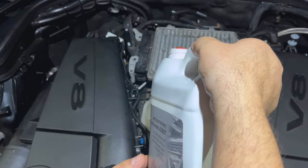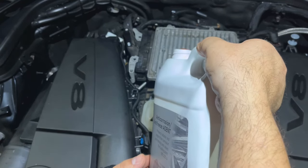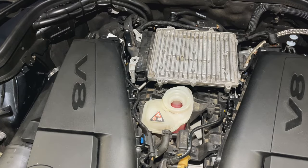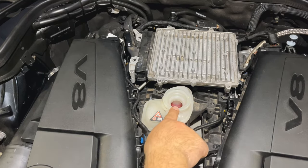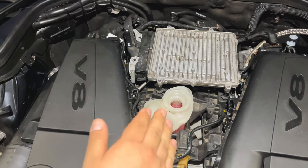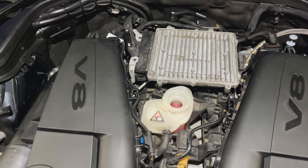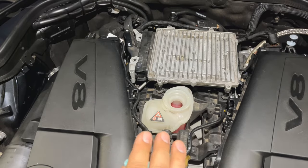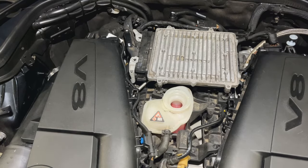Here we go, adding the coolant. Now you can see it's flush — just a little over that little plastic piece that's in there. That's our level. You don't want to go too high. Right now my engine is a little warm — it's been a couple of hours but the car is still warm. So I went a little past it so that when the car cools off completely it'll go down a little more — I might have to add a little more, maybe not, but that's our level.